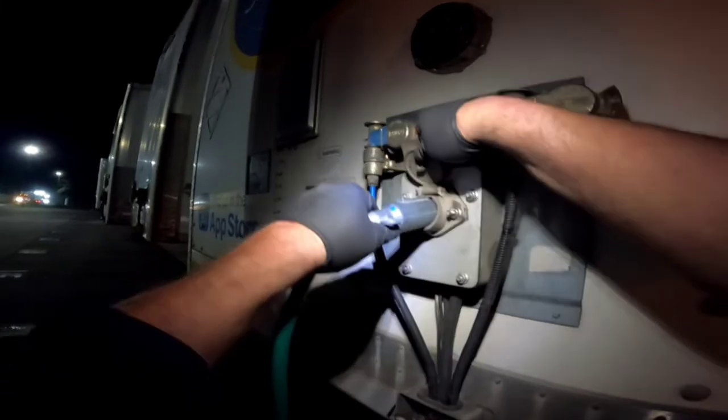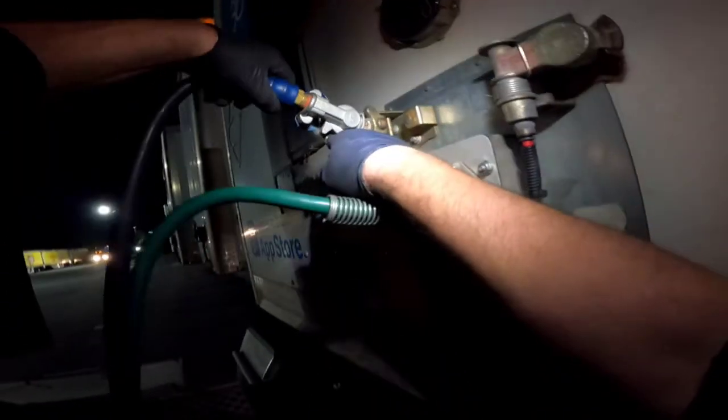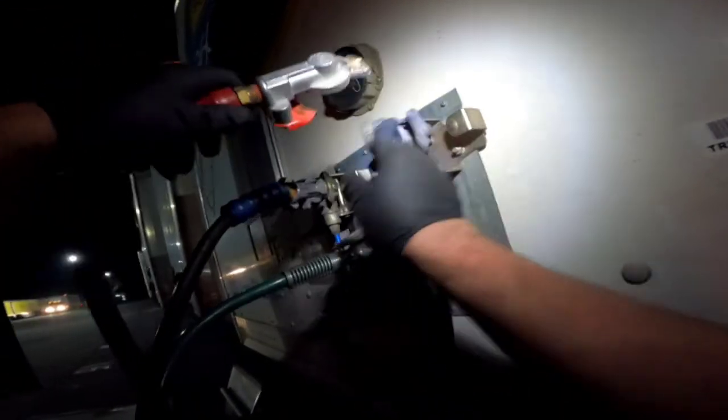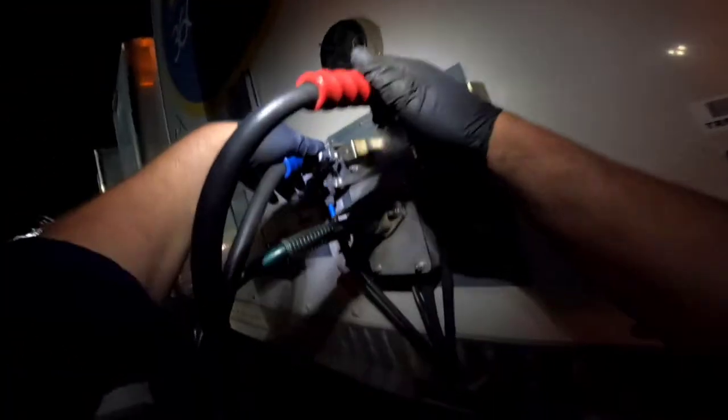I lucked out when I pushed on that tail light, and I saw it flicker on. Saw the midsection signal flicker. And I knew that was the problem back there. Saved me from doing a lot of tracking. There we go. What we got? Okay, so it's still lit up and all that. So we're gonna have them do the signals on both sides and make sure everything's working.